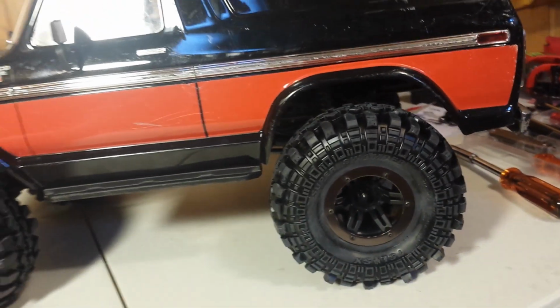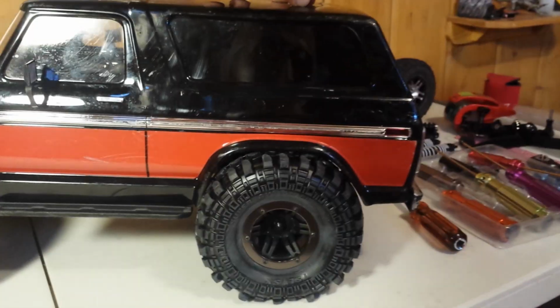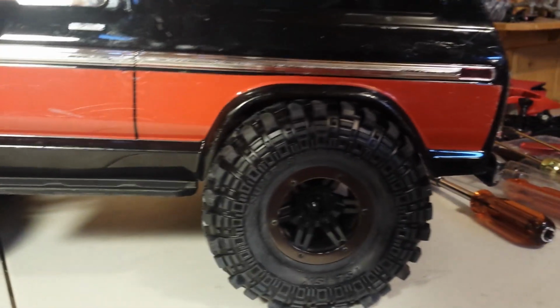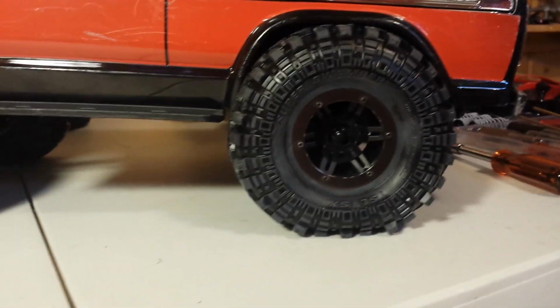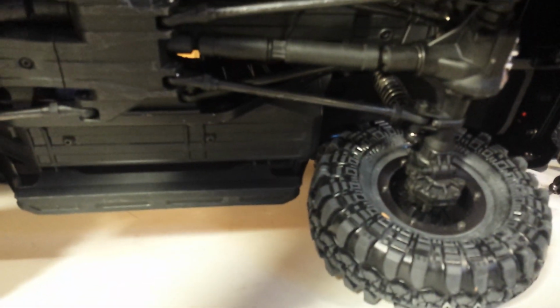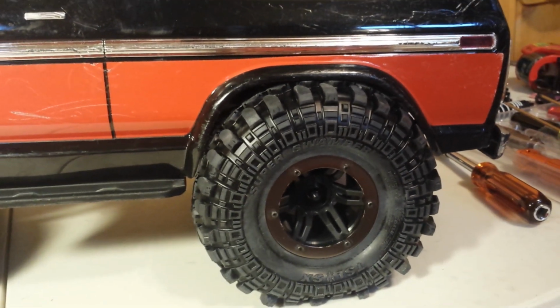All right. One of the problems I was running into is this right here. When I compressed the back, it wasn't centered. Now, it might not be perfect, but it's close enough now. I can't tell. Everything's all centered. I wound up having to take the bottom rods and turn them out. The right side I had to go out 2 full turns, and the left side I went out 1 full turn, and that pretty much centered me front to rear.